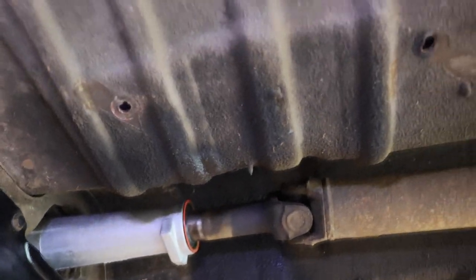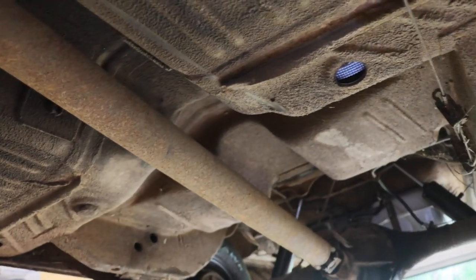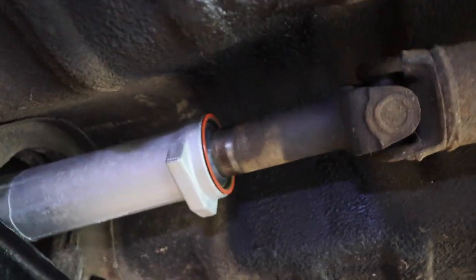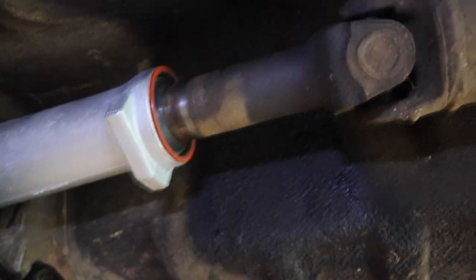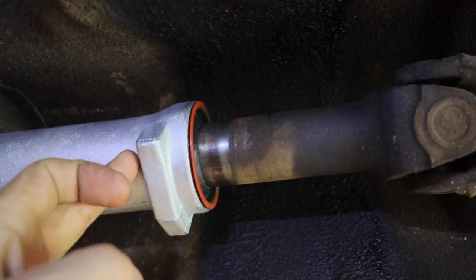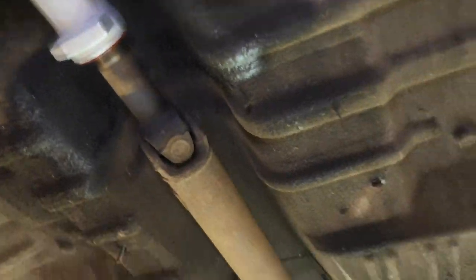The drive shaft is in. One thing I noticed — leave a comment and let me know what you guys think on this. I can't remember what the original OEM length of a '70 Coronet drive shaft is supposed to be. This right here — I know she's up on the lift and once you put her down it'll go in a little bit, but I already did put her down a couple hours ago and it goes in, but not that far. That's a lot sticking out, which means I probably only have about an inch in this tail shaft. It'll work to get it running and drive it down the street, but once we start getting serious with this car we'll need to address it.